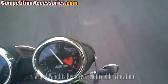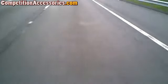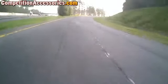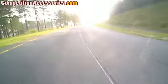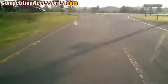I don't know if you can see, but depending on the speed — oh yeah, really — shaking quite a bit there. You can see my gauge is shaking. Tire balance is something that's pretty difficult to show on a video. But as you can imagine, you can feel it. Through the bars and in your mirrors, you can see and feel the vibration.